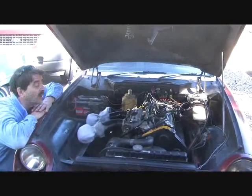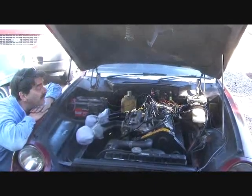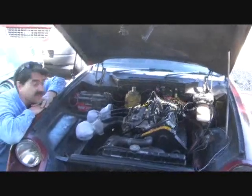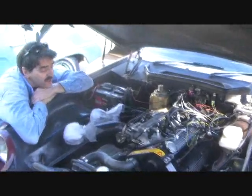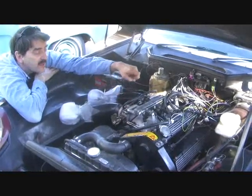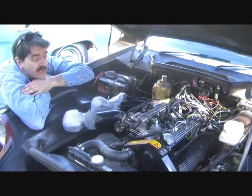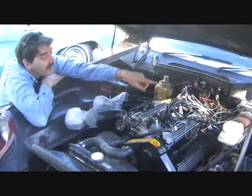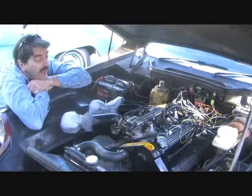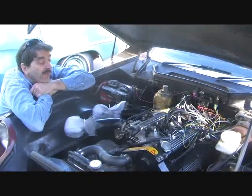This is a first revision of a fuel injection system for the Lotus 907 motor as fitted to a 1973 Jensen Healey. It uses a lot of creative use of parts that exist from other cars — the throttle bodies are individual throttle bodies off of a Nissan Maxima, the fuel injectors are off of a 97 to 99 Dodge Neon, and the fuel rail is out of a Saab 900 Turbo. Most of the ignition system is from a Ford Escort four-cylinder or a Ford Taurus.